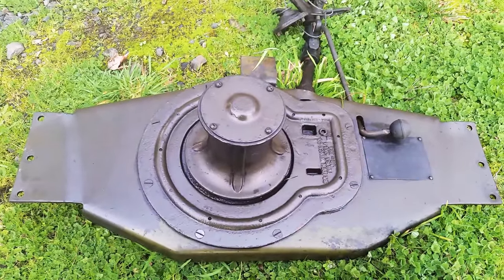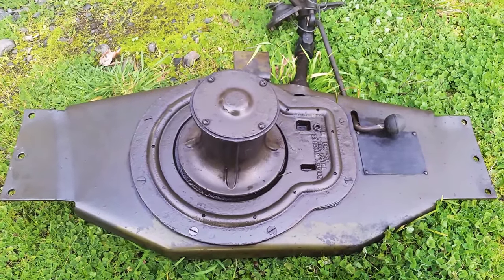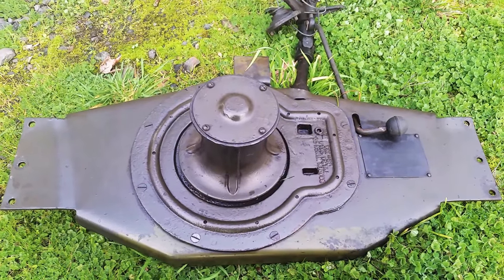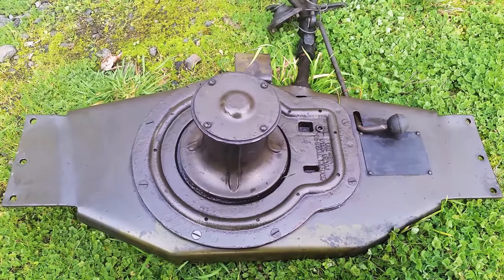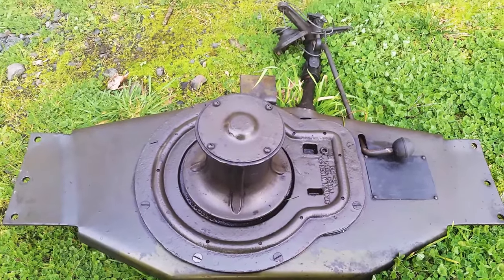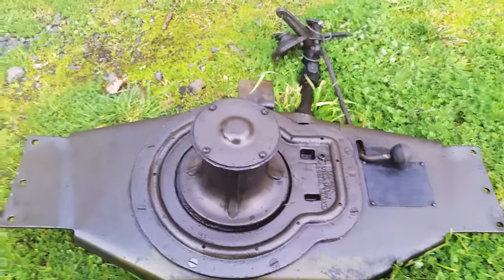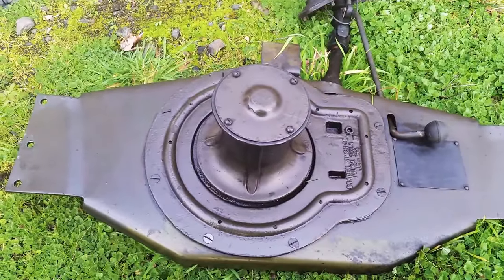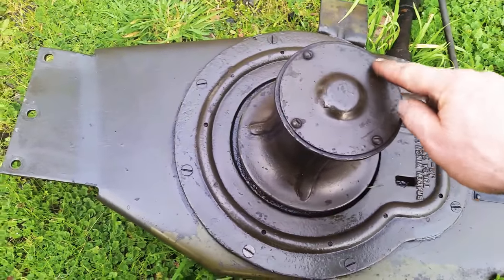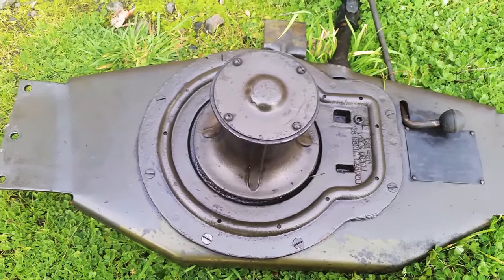My buddy Dave Arrow — he might be coming up to see this winch — has a website dedicated to the Braden J2 capstan winch. To my knowledge, although I could be wrong, this was the only capstan winch put on jeeps during World War 2. There's also a company called Link Belt that made winches. The distinguishing factor of a Link Belt is that they only had three flathead screws on the top spool, while the Braden J2 has four.